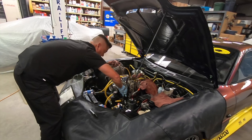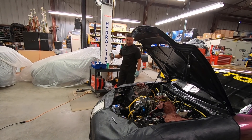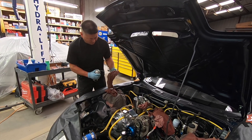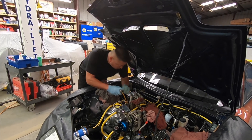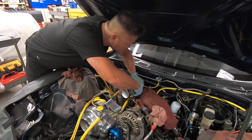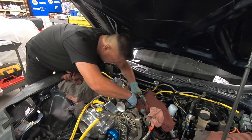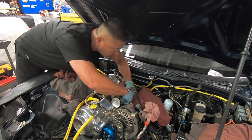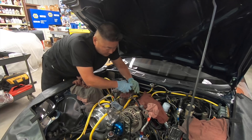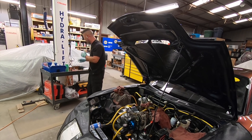That is exceptionally good news — everything moved quite easily. We'll take off the stethoscope and like I was talking about, we want to lubricate again at the 120 degree mark. We'll clear the straw first, make sure there's no contaminants, secure the straw so it doesn't go in, and get plenty of lubricant down there through the injector ports.